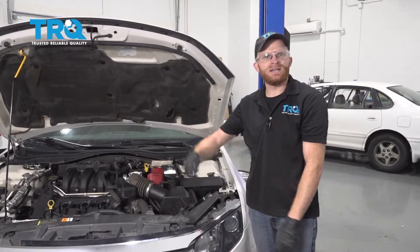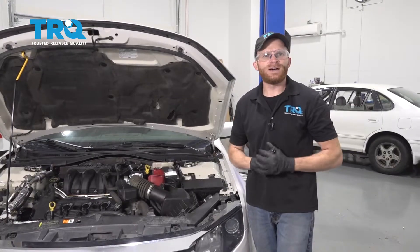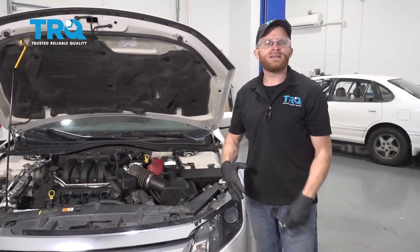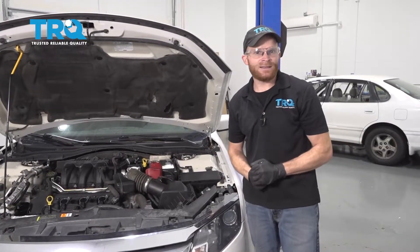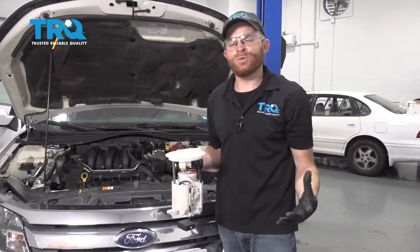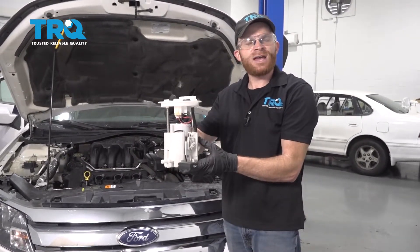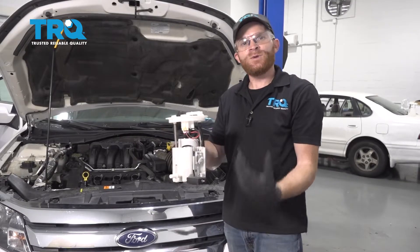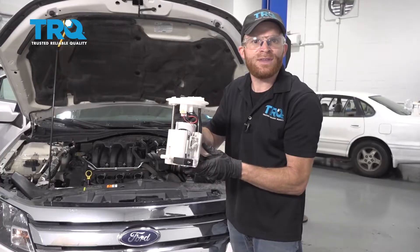To do this fuel pump, it's typically gonna be accessed through the rear seat of the actual passenger compartment. A couple things to think about is your fuel level offhand. If you're sitting approximately over half a tank of fuel, you're gonna wanna drain some of that out. We're gonna be dealing with fuel — make sure you have hand and eye protection at all times. Also make sure that you have the proper fuel pump. If you have the all-wheel drive version, you wanna make sure that you have this nub coming out the side right there.